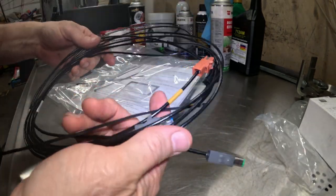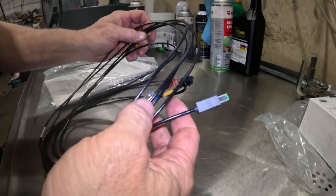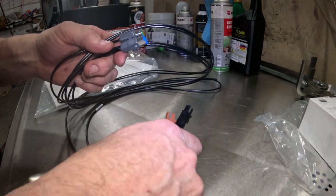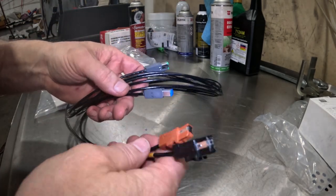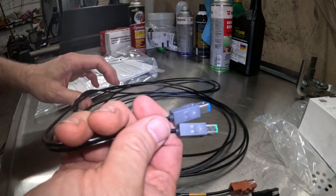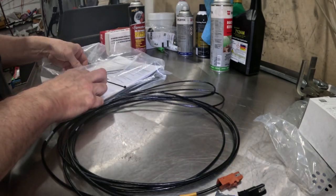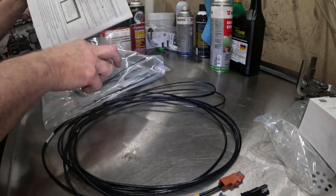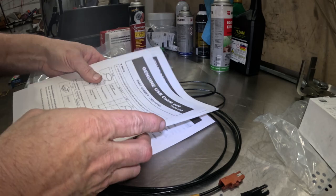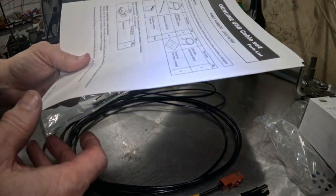And we need to take this wire and put it together and basically make a harness. So you're going to have black and brown on one side, and this will go to the hub, and then you have the blue and the green on the other side, and this will go to the back of the Connect Master unit. Here's the instructions for the customer on how to use Android Auto, Apple CarPlay, and this will go in the customer's glove box.